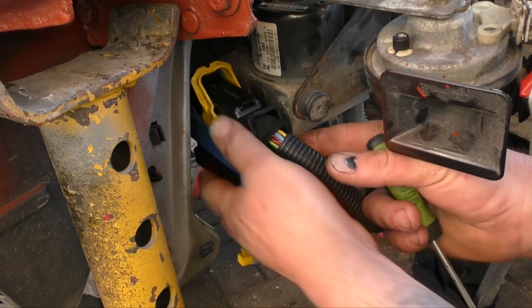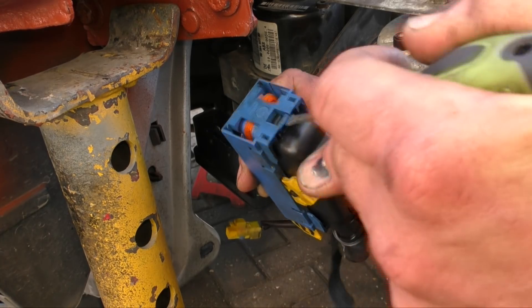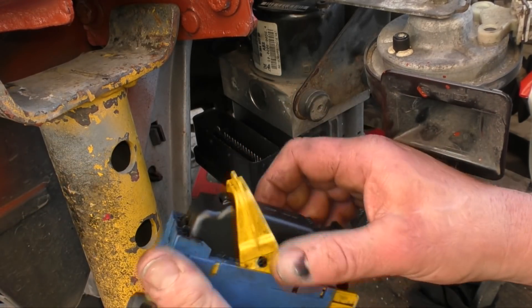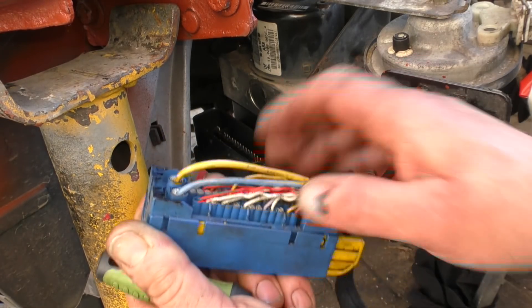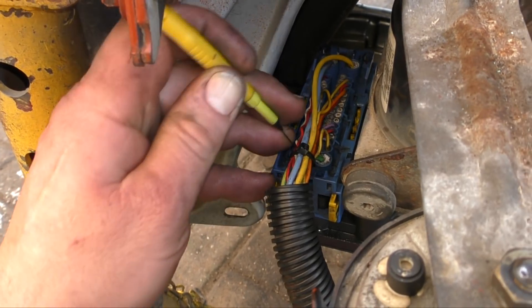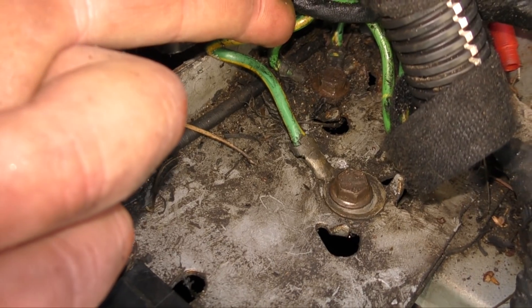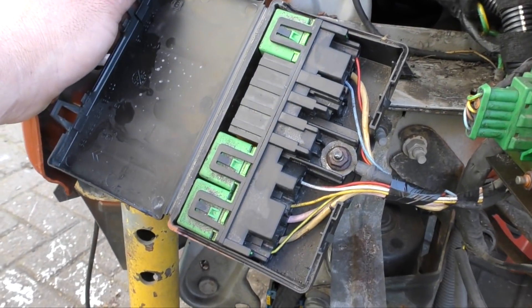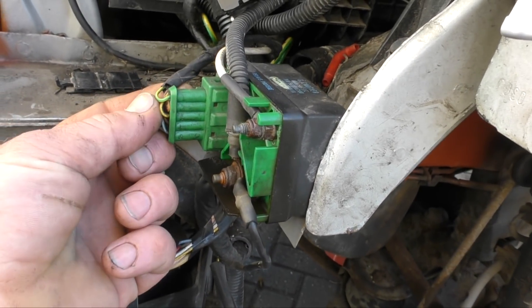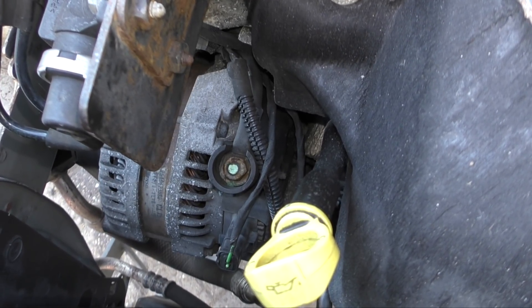The ABS — what happened here was it was actually working when it was wet and faulty when it was dry. I'm sure there was an electrical connection problem. The DTC when I scanned it said the pump was seized, or there was high resistance being read in the ECU on the positive usually. I pinned out all of the relevant connections — you've got two powers and two earths. What I found was a bad earth. French cars seem to have a green and yellow tracer for earth, and you can see the bad earth there. Once it's cleaned up it's all right, and I've checked all the relays to make sure they're fine. I'm still knocking out the tutorials and I've got a lot of work to do. French car terminals always seem to corrode for some reason.